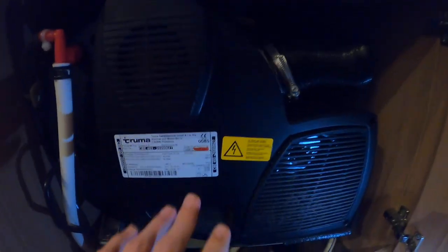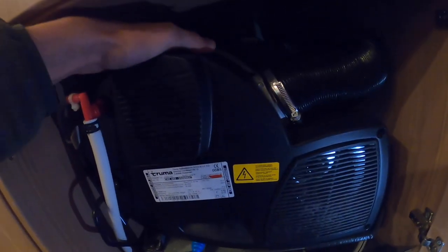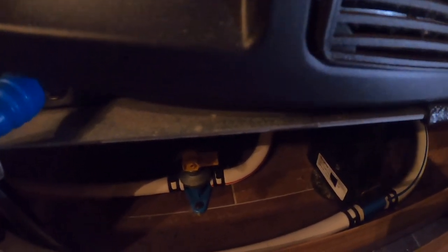Also underneath the wardrobe is where you will find your boiler — this is your Truma boiler and it holds 10 litres of water at any one time. In the winter it's very important that you let this 10 litres of water out. To do so, you've got a yellow toggle tap down here. When it's lying down it's holding water — you need to stand it up and the water will cascade directly underneath the chassis. Leave this up during the time the vehicle is standing to stop any water from freezing inside the boiler. It is very expensive to replace the boiler when the water freezes in it, and it isn't covered under warranty — it's your responsibility to drain it. To drain the boiler down, once you've allowed this toggle to stand up, make sure your fresh and your waste are open and open all your mixer taps to the middle position to stop any air from building up. Also take your shower hose off — take the head off and allow the hose to lie in the shower tray to stop any water from freezing in the shower hose. And that is how you winterize a motorhome.